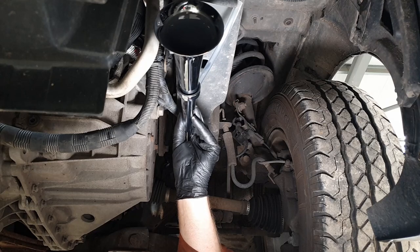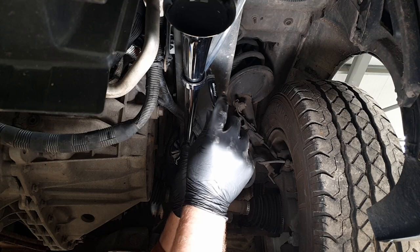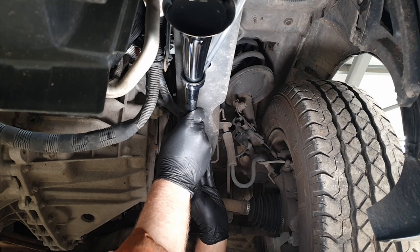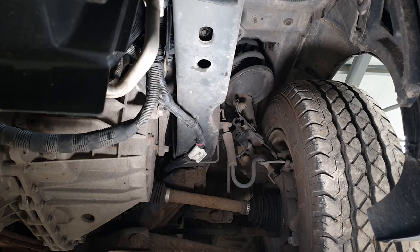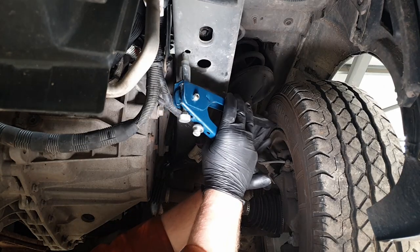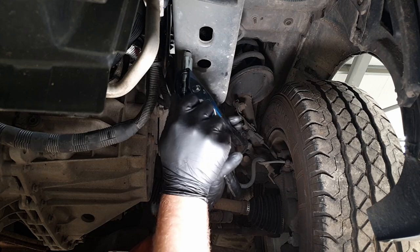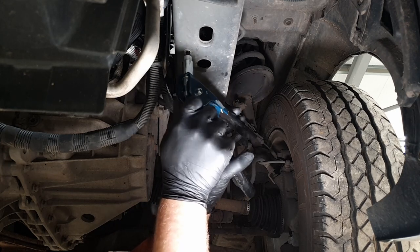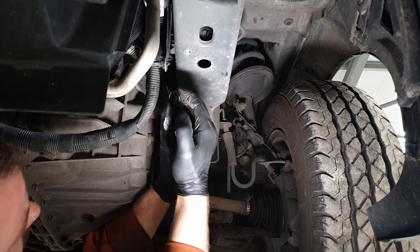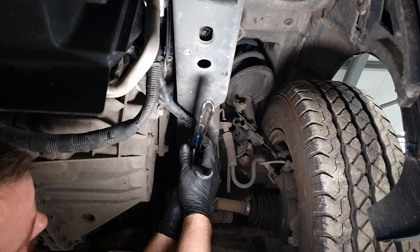The last thing is mounting the horn. My vehicle has an aftermarket body kit so your situation may differ. I marked two of the three holes with a felt pen - two holes is plenty for something this light. I used nutserts - I had a rivnut gun available so I riveted two threads in there to bolt into. You could also just cable tie the horn in place if you prefer. That's the front nutsert done - now drilling and riveting the rear one. These rivnut guns are really simple to use and work very well.